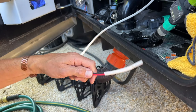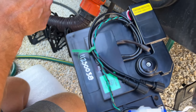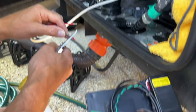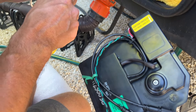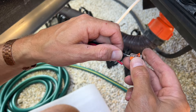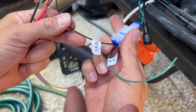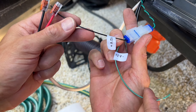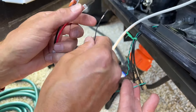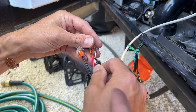We've got our wire run and we've got power to it. Now we're going to do a preliminary test — getting it stripped, crimped, and connected to the physical motor itself — so we can test to make sure this motor is good before we tear everything apart. They also say to check for polarity in the electrical, which is what that green little indicator light is for. According to the layout they give you, black is positive and green is negative, so we just have to switch that around: red is our positive from our box and black is our negative.